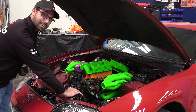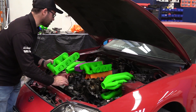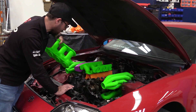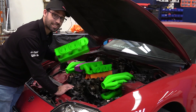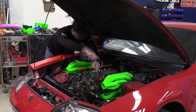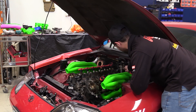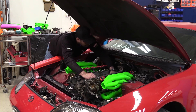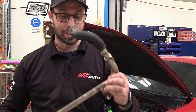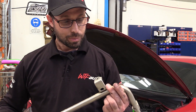The problem I've got here is that there are all these heater lines at the back of the engine which are stopping me putting in the second part of the intake manifold. So I'm going to have to pull all this apart just to get rid of these metal lines, which pipe all the way down the valley. We're not going to get rid of this pipe because I do want to have a heater in this car, but I'll at least have to chop it and lengthen it a bit so it clears the new intake manifold design. We'll do that later.